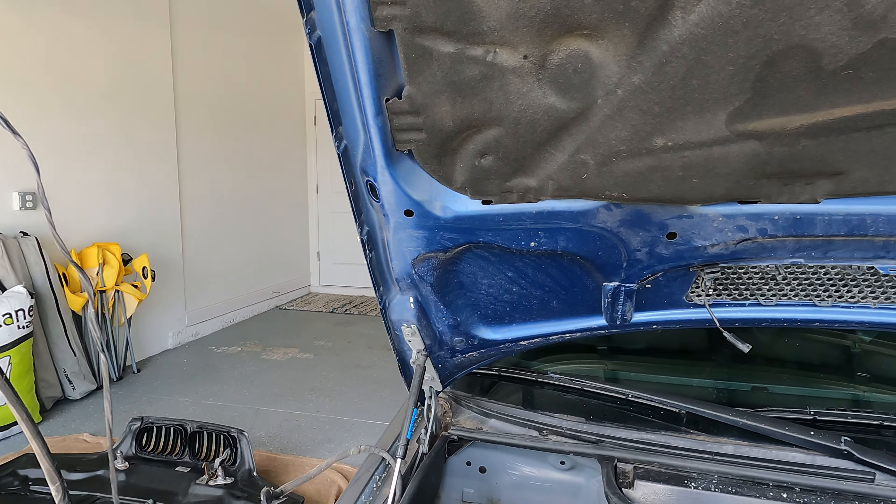I'm going to shut this very carefully right now. A good rule of thumb: do not try to latch it until you have it perfectly lined up, because it might get latched in such a way where you cannot get it off. It actually looks pretty good on that side, but the hood definitely needs to go to the left a little bit. A good way to do this is just loosen all these a little bit. After some time moving the hood back and forth until the gap looked good on both sides, we're ready to move on to the windshield washers.